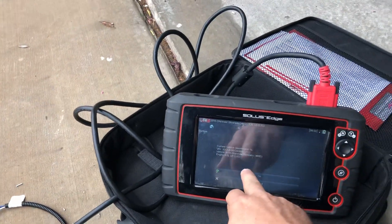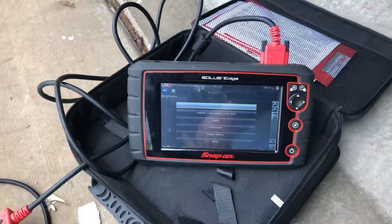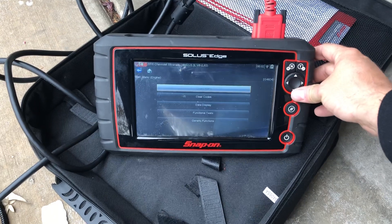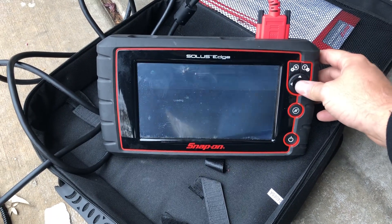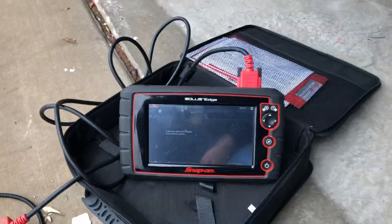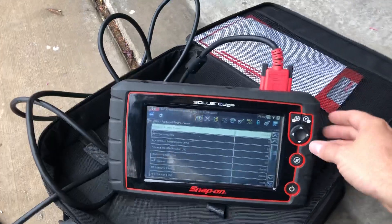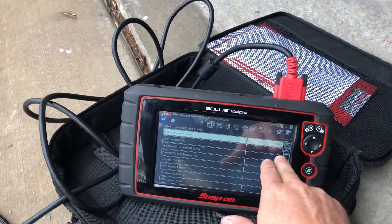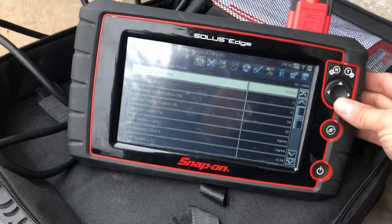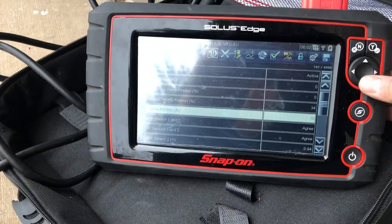All right, I have your computer hooked up. This is a 2016 Silverado 5.3. Going to engine — since this is running a Corvette pedal on a truck operating system, I rewired it to work right. This says reduced engine power. This is because the fuel pressure system isn't hooked up — the fuel rail sensor has to be hooked up or it just goes into reduced power.